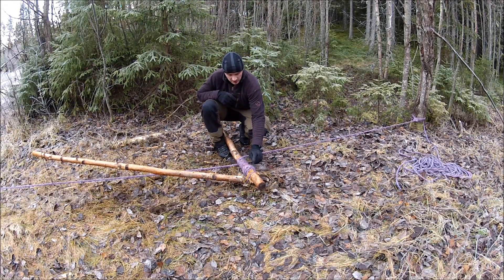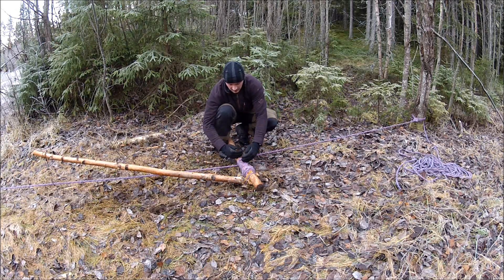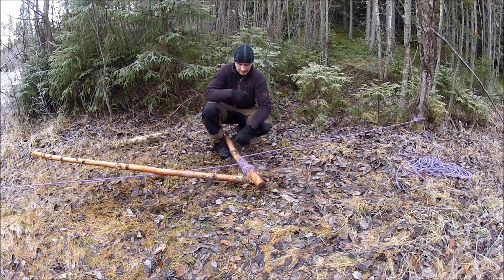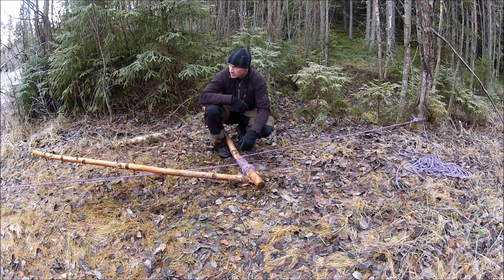You can see at the start I had some issues. I didn't get the right pattern where the anchor point direction and the vehicle direction are lined up. If they get uneven you'll have a terrible force in the log as well. Then you will have big problems doing it alone. But when you get it wound up nicely you can pull an almost two-tonne vehicle out of a hole.